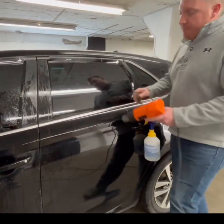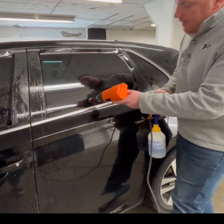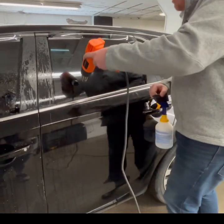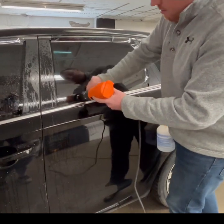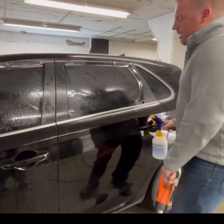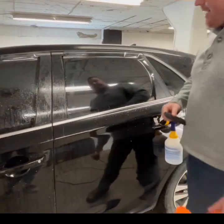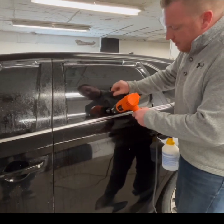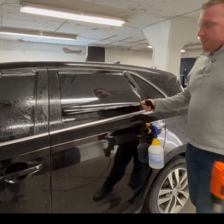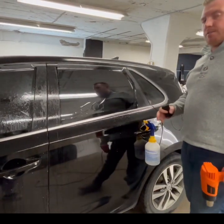If I don't have any fingers, I'm going to test the film to see if they pop up. I'll take my heat gun and go slowly on the bottom of the film. The angle is very important — I don't want to come up because I can burn the film; I want to stay over top about a half inch off. Once I've done that, I'm going to spray it down, spray underneath the film, create my N, and push all that slip solution out to make sure we've got a good shrink. In our courses we always suggest shrinking twice just to make sure fingers don't pop up. If I take this film off the glass, we can see squiggly lines — those are our shrink lines. When I go to install this film, it's going to follow the curvature of the glass.